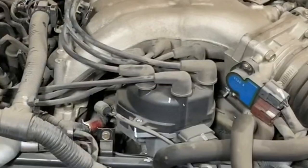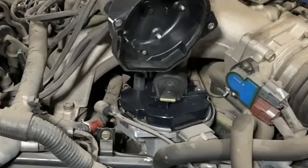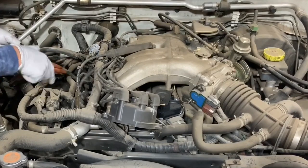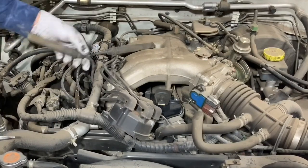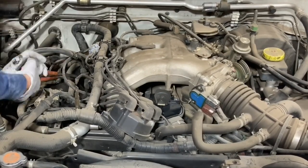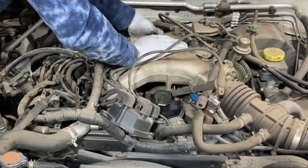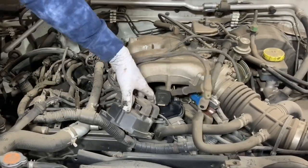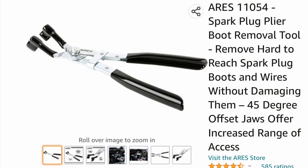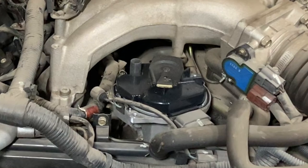Once I labeled all the spark plug wires, I went ahead and removed the two screws holding the distributor cap to the distributor — that was a Phillips screwdriver. Then I pulled the spark plug wires off the plugs themselves. Because these were so old and original, I had to use long needle nose pliers and leverage against the intake manifold or valve cover to get some of them to pop loose. This is why, if the vehicle is this old and wires look original, you might also want to do plug wires and not just spark plugs — I did end up damaging a couple trying to get them off. You can also get a spark plug wire removal tool on Amazon for pretty cheap to assist with this.